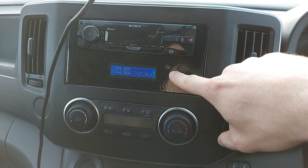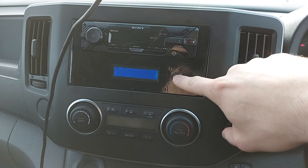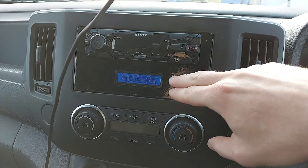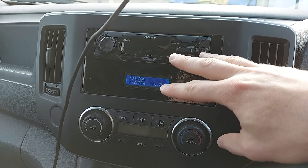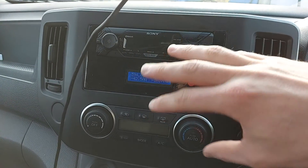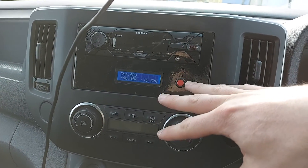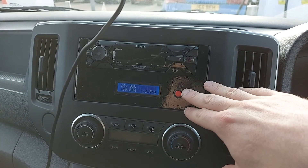It's got this button here where I can switch the thing on and off. I just need to be careful because I don't want to be accessing the cell voltages and temperatures while driving or charging — apparently in some cases, if it interrupts the CAN bus at the wrong time, you could get some serious problems.